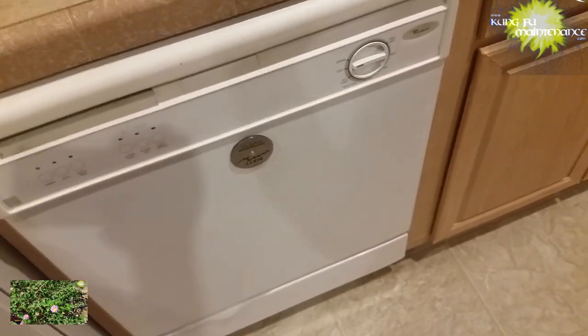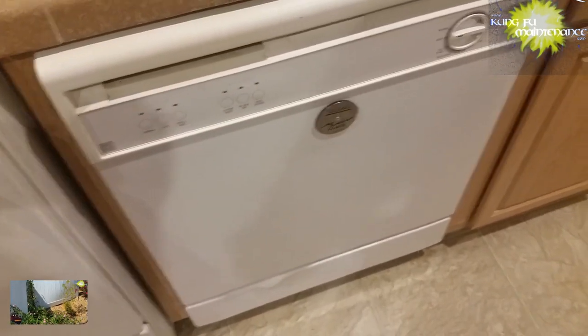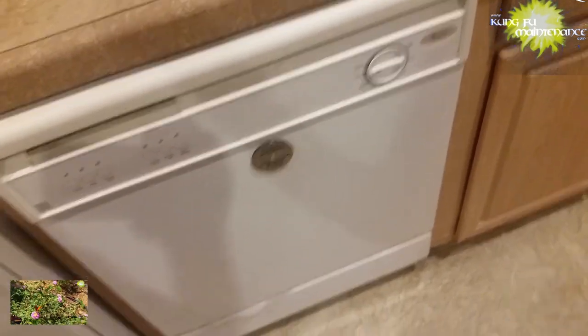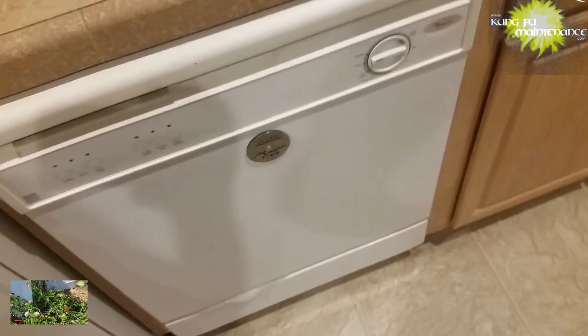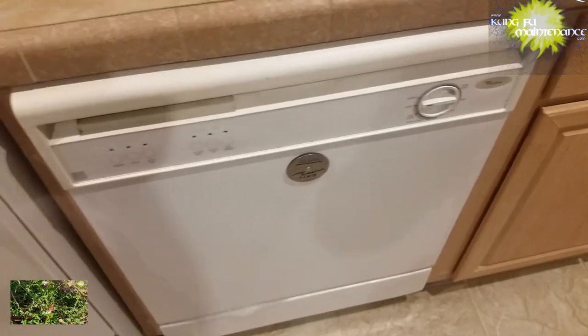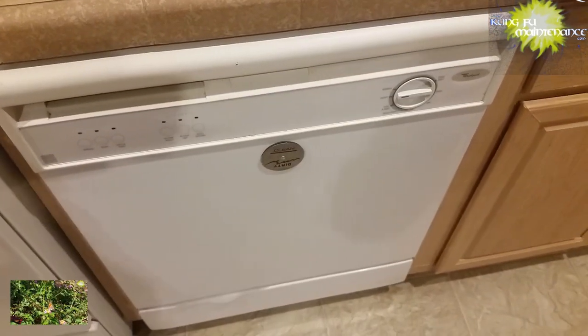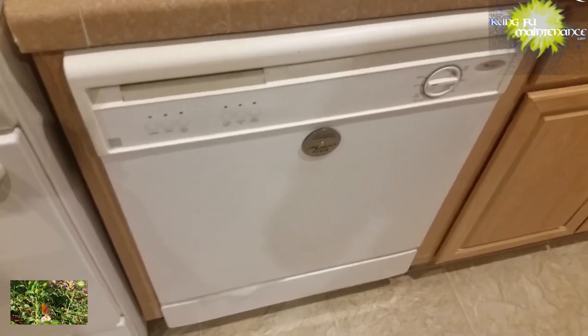Because dishwashing soap has a high foam content, mixing it with hot water, it can work, but it's just not recommended, not really what it's for. Dishwasher detergent, much better. But in a pinch, if you use the tiniest little bit, it can get you by. But you're going to want to make sure that it rinses extremely well, which may mean you want to run the machine with no soap and just a whole other cycle to make sure it all gets rinsed off. Nice hot water.